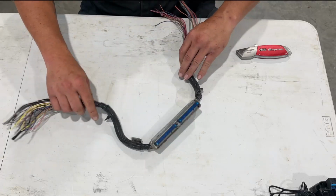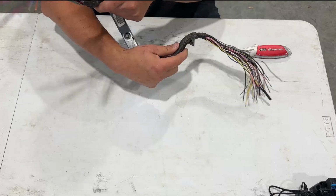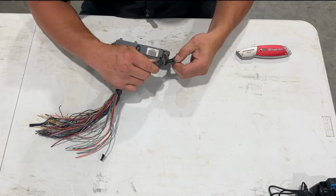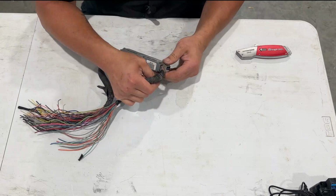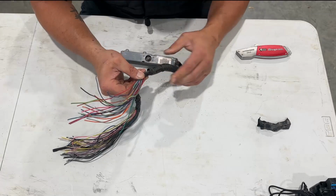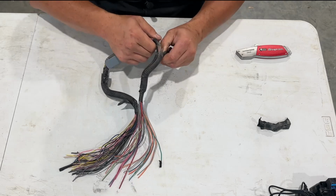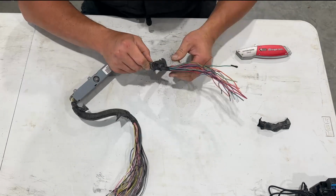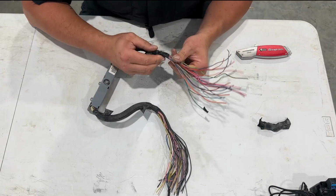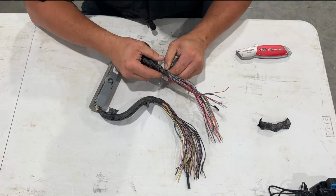All right, so there's two sides that come out of the blue harness, one on the left, one on the right. So what we'll do first is we're just going to start taking apart this loom and get this tape off. And of course, this was in a truck, so it's dirty and grungy. But there is an easier way of doing this, by running your utility knife down here, which we might do in a minute. But for now, let's see if we can unwind it, because sometimes that's easier. And as I say that, we've run into a spot that doesn't really, well, there we go.